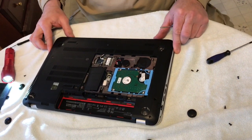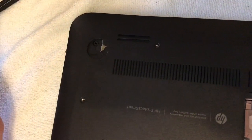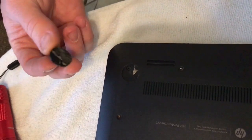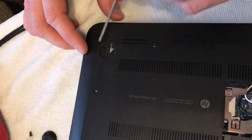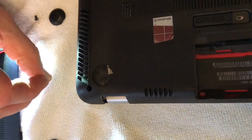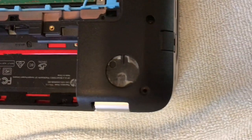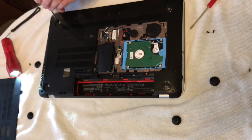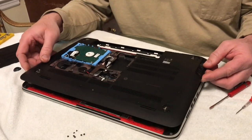I'm still battling trying to get this cover off — felt like something was holding down in this corner. I ended up prying the little rubber feet off, the ones the computer sits on to keep from sliding around. There is a screw underneath each one of the feet on this side. I also pried off the ones on the other side — don't think I really needed to since there's no screw on those. You will have to pop just the two off that have screws; you can leave the others in place.